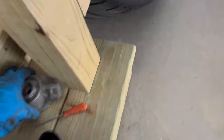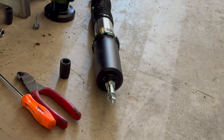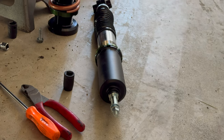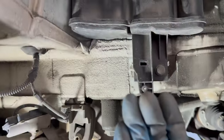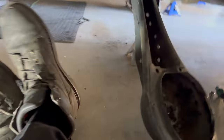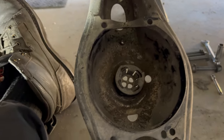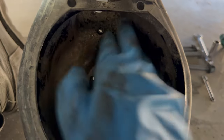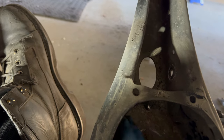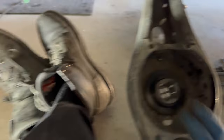We'll just take this — it switches to a 13. So we'll take this, plop it on there, hit it with a 13, just snug. They don't need to be crazy or anything. You don't want to snap that shaft there, those threads. Now we're just going to match this side, toss this side in. As I was saying earlier about this doohickey evap, it came off way easier than it ever has in the past on any MK7 that I've touched. Got these in 16. One thing to show you guys — your control arm won't fall down like this if you have a really nice spherical bushing in there. But there's going to be a big old nasty, hard-to-pull-out rubber piece that's kept in by some edges that poke out the sides and keep that spring from falling. We'll take the new one, slap it down in there, and the spring will go on top of that.